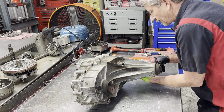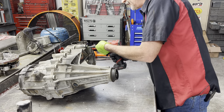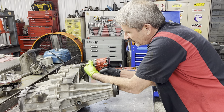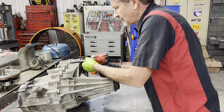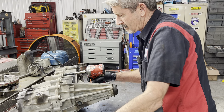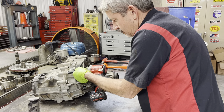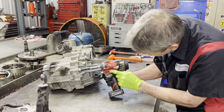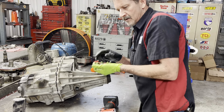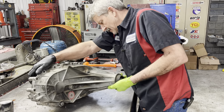This thing works really good. Now they put plenty of bolts in these things. This is a 246 GM transfer case. Every time I hit the trigger, it tells me my battery power. So really got a nice impact right there. You can see it already popped off — it's out of the snap ring groove here. See how the bearing snapped out of there? So now I should be able to just pull this off without much effort at all.